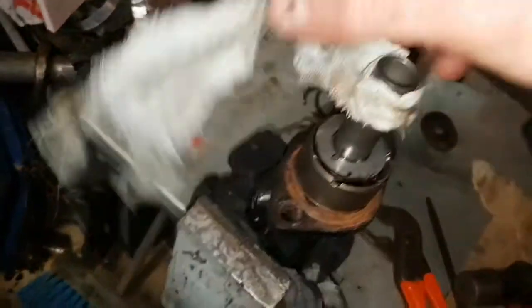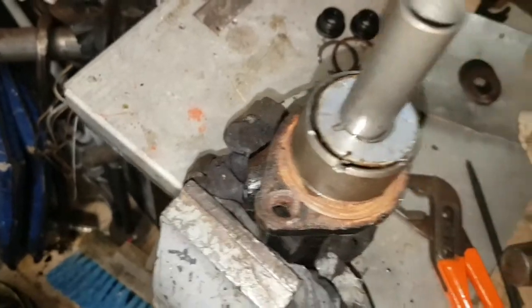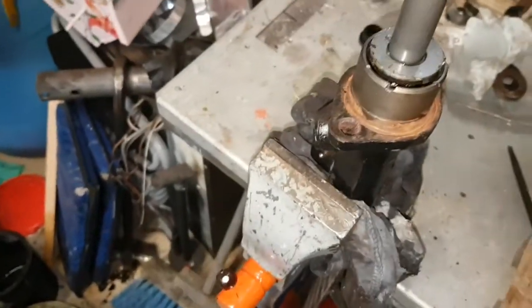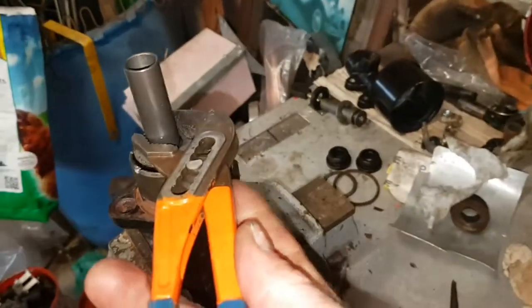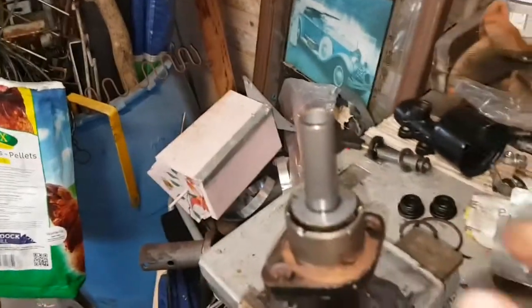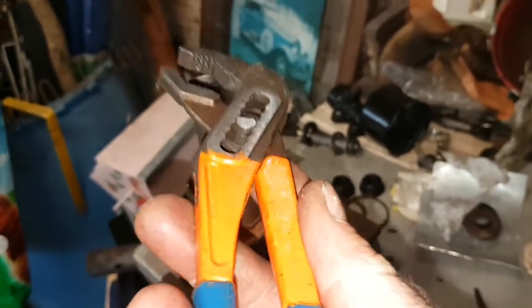I wrapped this shaft — see there — in a bit of cloth to protect that shaft. I didn't know how to get that out. It's obviously stuck in there and it wouldn't come out. If it's brand new it'd come out easy. I wrapped that around there, a couple of turns, and then put them underneath — like on there, like that. And then I gently tapped the hammer underneath. See my finger tapping there, underneath — and that released it. It shot up. Obviously it's spring loaded, but that released it. So a bit of rag around there — hold it reasonably tight — hammer underneath these water pump pliers. And it lifted it up.